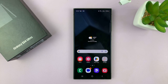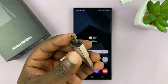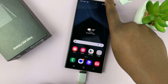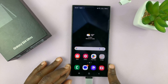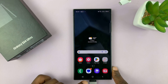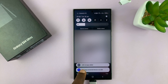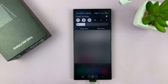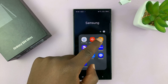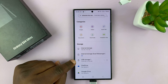The first thing you want to do is connect the USB flash disk to the adapter, and then connect the adapter to the phone with the flash disk. Since the Galaxy S24 has OTG support it's going to detect that a USB storage device has been added, and you're going to see a notification telling you USB storage added.